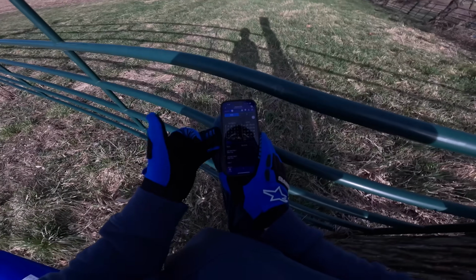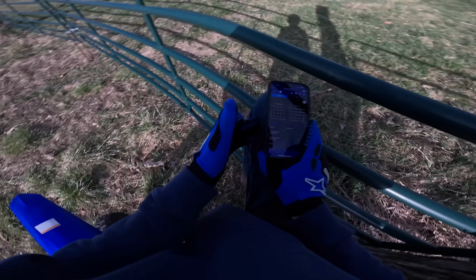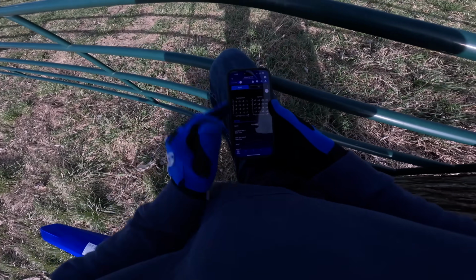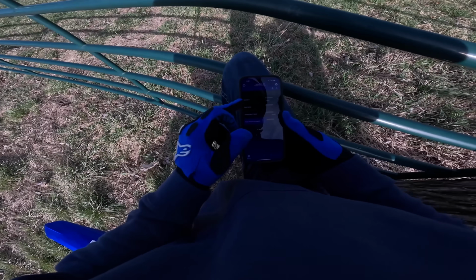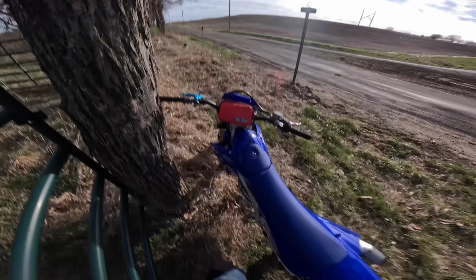I know the app is not going to let me hurt the bike, but like, lean is mean. I know it makes your motor run mean, but it's also mean to your motor, if that makes sense. So I didn't want to take too much fuel out there, but I added all the ignition timing. So it's going to rip on that one. It's not going to rip on this one. It's going to be about a normal 450 on this one. So I got dialed way back and normal loaded up on the bike right now. So let's just see what that does.